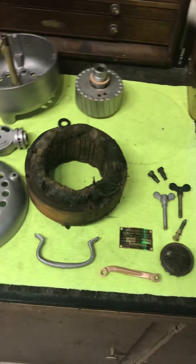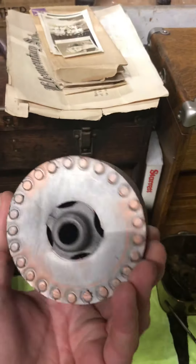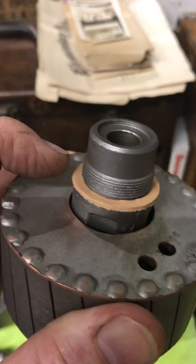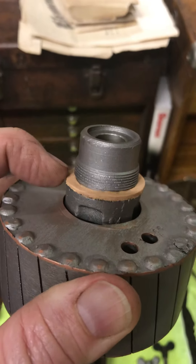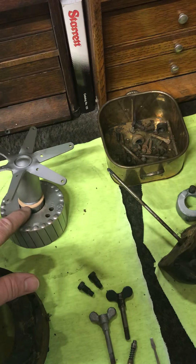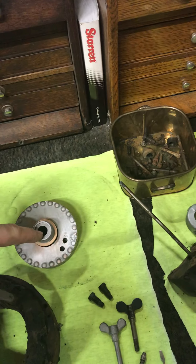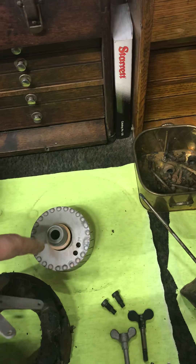The stator I've not done anything with yet. I've cleaned up the rotor — the rotor's all cleaned up and ready to go — and I've got a new leather rotor seal on here now. This leather seal right here is what keeps the fan from slinging oil. When the blade hub goes on here, it screws on and seats down against this leather seal. There's oil in this blade hub because oil goes through an oil gallery down inside this rotor, and this oil recirculates.